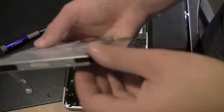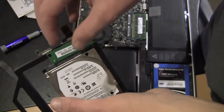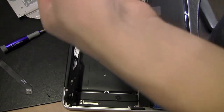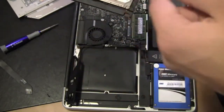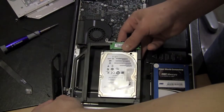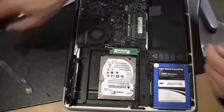There's a bracket on the back of this drive — I've already taken it off. We need to install that on the data doubler. It's installed right there as you can see. There are two black screws that OWC included which go right there and right there. Use the screws that Apple provided for every other connection. I'm going to slide this guy in, then pop down that connection and screw in the screws.